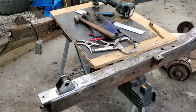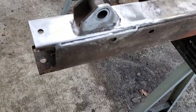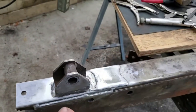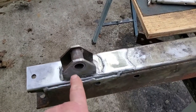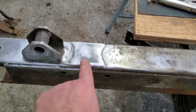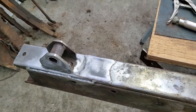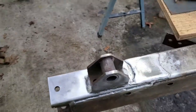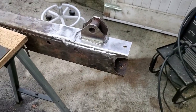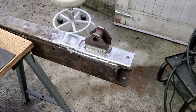I've got this piece on with a little curve in there and I've mounted up the old suspension mount. I cleaned out the old leaf spring mount and where it attached I did a flat straight weld, but then I put a fish plate over top to help distribute any load or pressure — proper frame weld technique. Not the prettiest welds in the world but I'm pretty happy with it; good penetration is all that matters.